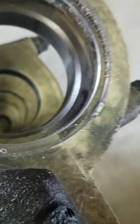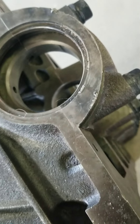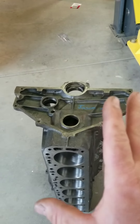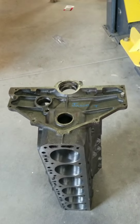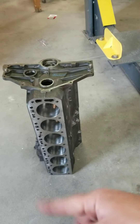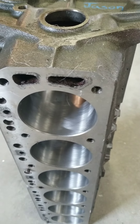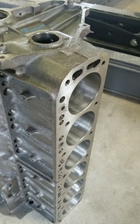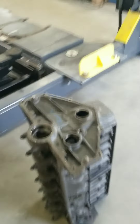We've got some type of sharp little slag, possibly damage from the machine shop. So I'm going to do everything on the back side, put it on the engine stand, and that way just in case I want to, I could vat it with the engine stand bracket on. Then when I take it out of the vat I could put it on the stand, wash everything, rotate it, and make it nice and easy to clean. I told the machine shop not to vat it and to leave all the honing oil on it - that'll keep it from rusting while I was waiting for an opportunity to get to it.